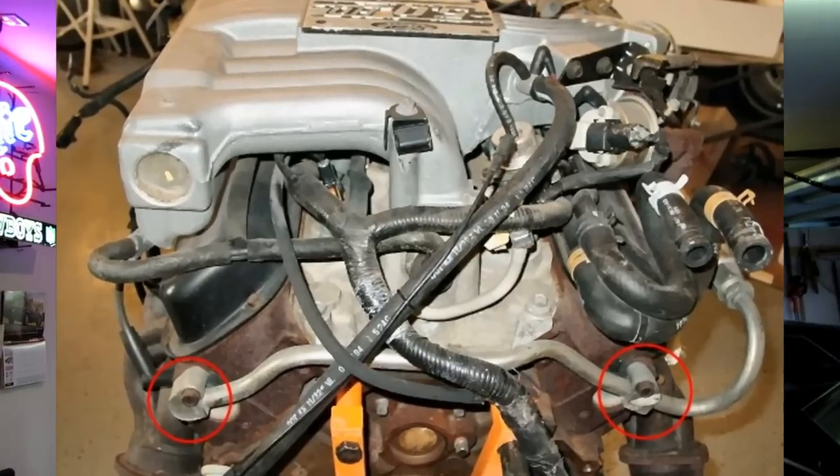One important thing to note: you have to block the heads when you remove the smog equipment. We're going to remove the solenoids, pipes, hoses, and the crossover tube from the back of the heads. The smog pump pumps air into the back of the heads and down to the exhaust to help emissions at the catalytic converters. Getting rid of this won't affect the computer - getting rid of the EGR will. It's already throwing a code detecting it's not seeing the expected air from the smog pump, so the code stays but the pump goes away.